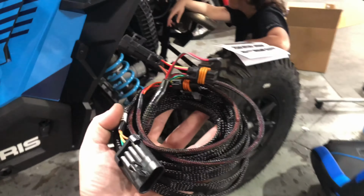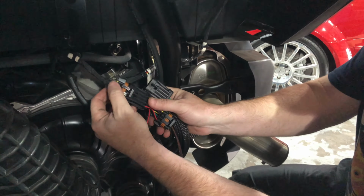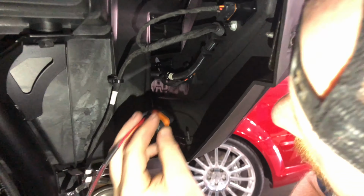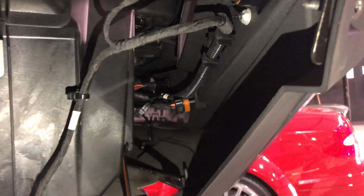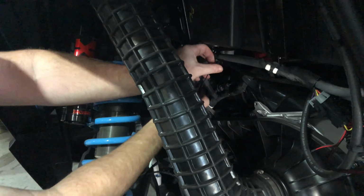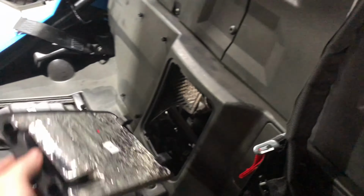We've got the wires all ready to go. We're going to run those from the rear to the front by tapping into the rear taillight section. This is an easy plug and play for the factory position. You just split that with the Y harness and there you go. It also has the system to plug into for the rear license plate. You can see reaching back there, unplug, plug that in. You now have license plate going. So we're going to zip tie this thing up, run it all the way along some existing hoses and wires and push it through the firewall right here.